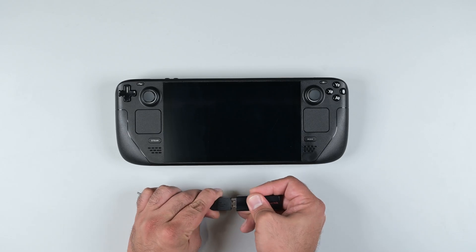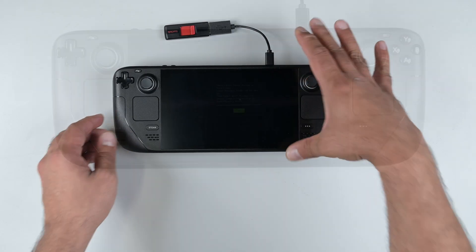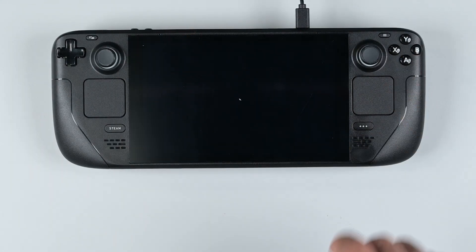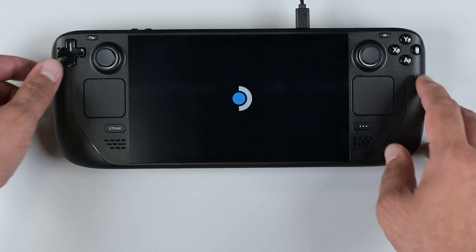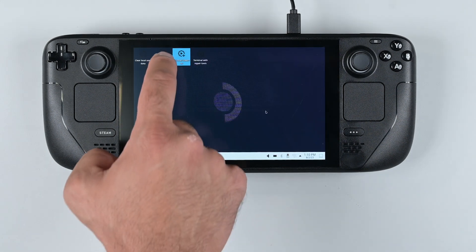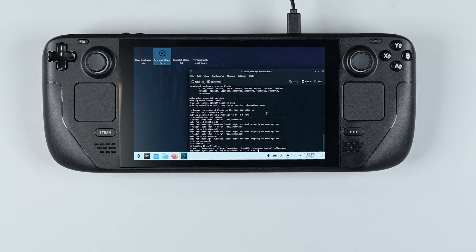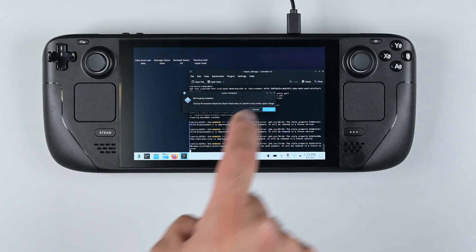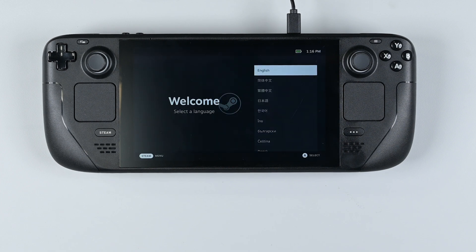Next up, plug the newly imaged USB stick into your Steam Deck and power it on. Hit the A button on the next prompt, go over to Boot Manager, and select the external drive. Wait a few minutes and you should see a desktop with four shortcuts. Navigate to the Re-Image Steam Deck shortcut, accept the following prompts, and wait for the installation to complete. Once the install is complete, reboot the system when prompted. At that point, it's safe to disconnect the USB drive from your Steam Deck. That's it — you've done it. Your Steam Deck is now reassembled and ready to take on the gaming world once again.